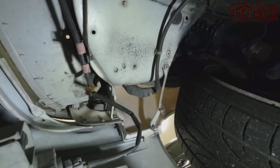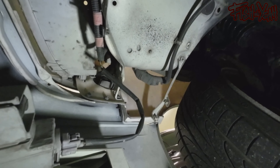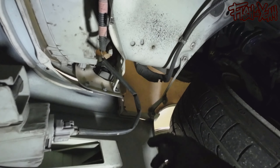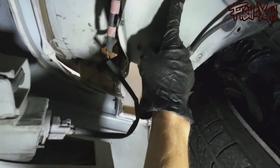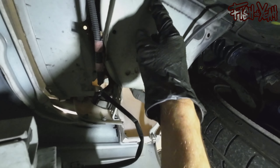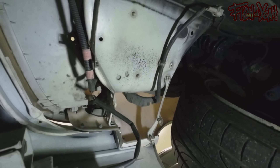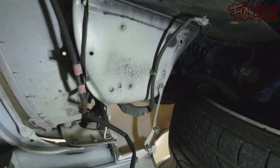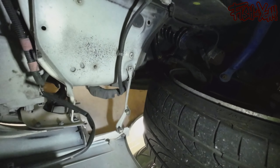Sorry for the jerky camera. Here we are underneath the car. I asked around, but everyone that has a 100 series already has a front mount intercooler and no one has a stock mount, so I was trying to find out how it actually mounts. Best I can figure is that this bolt hole is where one of the mounts would go. I'm going to modify this hole with a nut cert so I can bolt the intercooler up — just pinch that, push it up, re-drill it, pull a rivnut in, and everything is easy — nice 10mm. I'll film this from the top as I drill it.